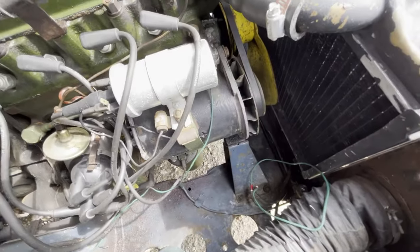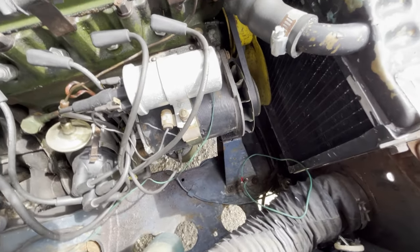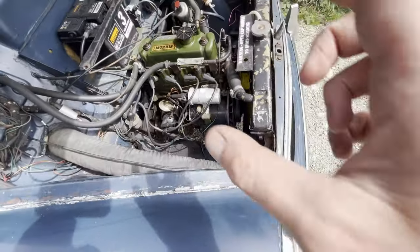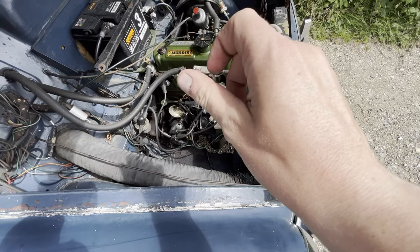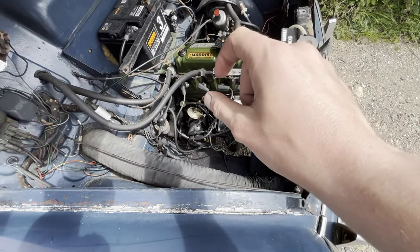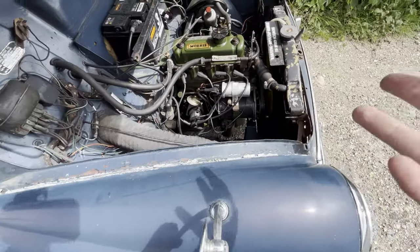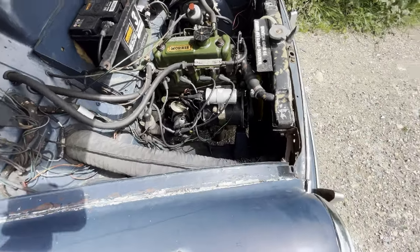That's the beautiful simplicity of these old cars. Most modern cars don't tend to have pressure switches anymore — they tend to have a switch under the brake pedal. When the pedal's up and your foot's off it pushes on the switch and breaks the circuit, and when you press the pedal it lets the button out and makes the circuit. But you can do the same diagnostic under the dashboard — just take the wires out, bridge across, and if the lights come on you're away.